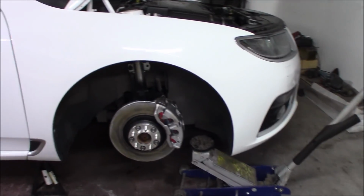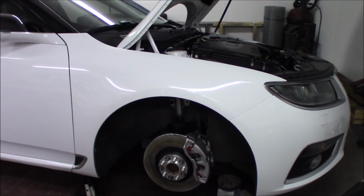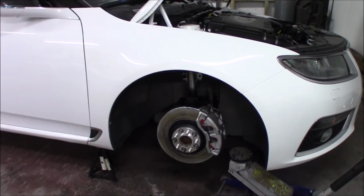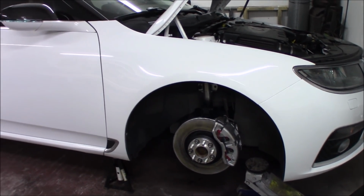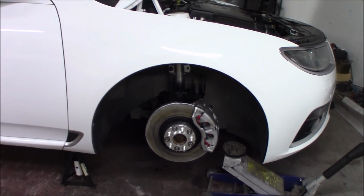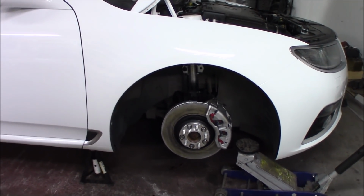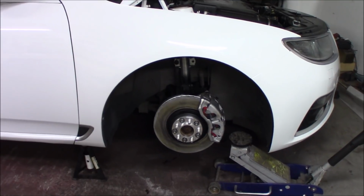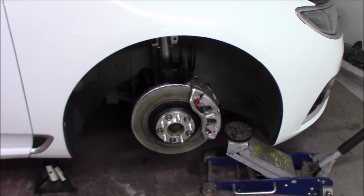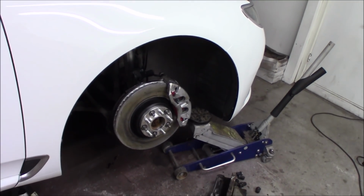So after you have bled the brakes and filled up the reservoir, when you push the brake it should feel just numb. It shouldn't go anywhere, you just press down a little bit, then it should go completely numb. Then you have got it completely correct. It should not feel soggy and just slowly go to the ground. It should just go down fast and stop. Pure and simple.